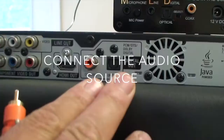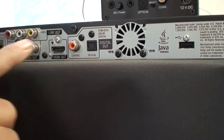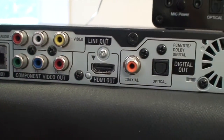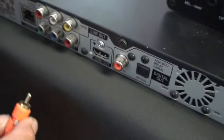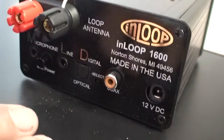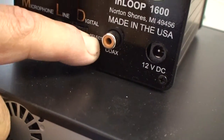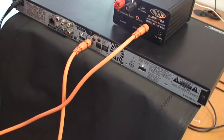We have our outputs on the back of the unit. We're going to use a digital coax. You can see the difference between the digital coax connection and the RCAs — RCAs are multiple, with a red and a white for audio. The digital coax will always be a single output; in this case, it's orange. We connect it here at the back of our unit, where we have our coaxial connection and a selector switch. It was set to optical, so we slide that switch over to coax, connect our coaxial cable, and now we're connected.